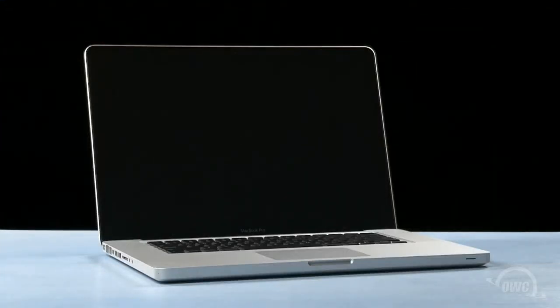Hello and welcome to the OWC instructional series of videos. In this installment, we'll show you how to add a second drive in the early 2011 and mid-2012 15-inch MacBook Pro. We'll be upgrading a 2011 MacBook Pro in this video, but the steps and positions of everything are identical for the 2012 model. In most cases, the optical drive is held in place with small Phillips screws, but there have been instances where Apple has used Torx T6 screws instead. Make sure that you have both screwdrivers handy before proceeding.